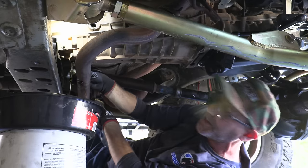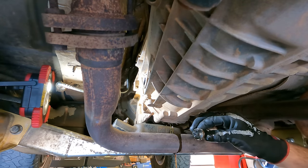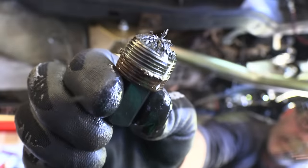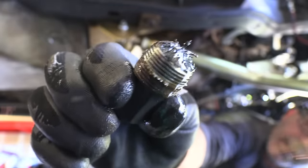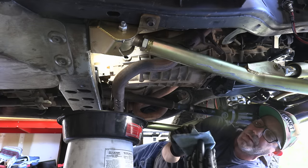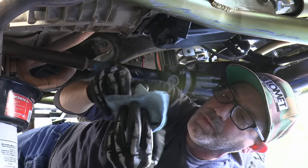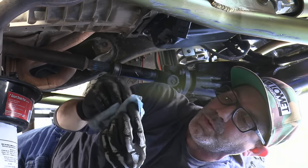You'll notice it's going to drip on the exhaust pipe a little bit — no big deal. Some guys put aluminum foil on the exhaust pipe, but there's no need. I have brake cleaner and Lucas oil degreaser that'll take three sprays and a wipe of the rag. Let's analyze the plug — before cleaning and after. At 70,000 miles and nine years of use, that's not bad. This is my first time doing it. Look for big chunks; if you see shavings be worried. I don't see any, so we're good.